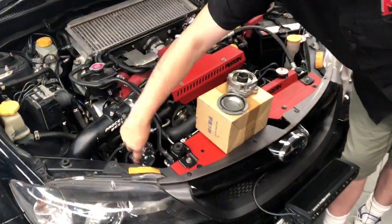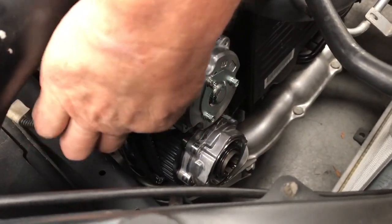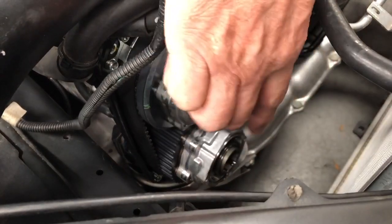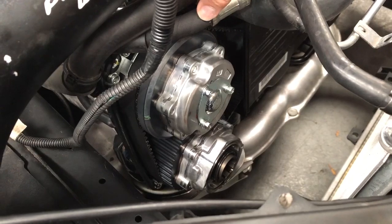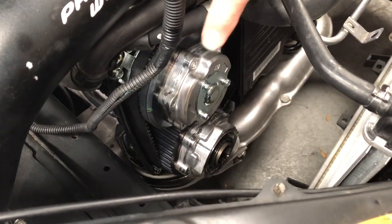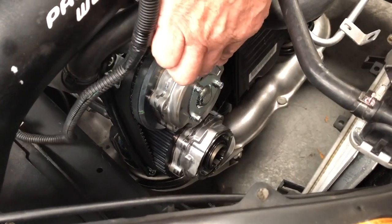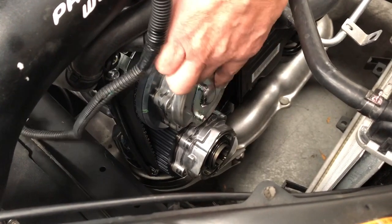On the tops of the front of the engine, you can see they've got a larger nose where the cam pulley connects to the belt to the camshaft which is inside the engine. This part here is variable internally for allowing the camshaft to advance and retard while the engine is running, and also on the exhaust side. You'll notice this one here has got the cover over the top because inside there's oil pressure and an o-ring.